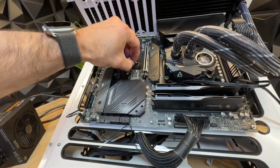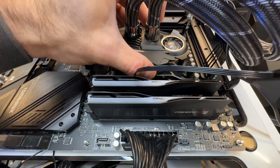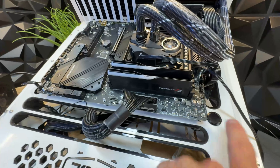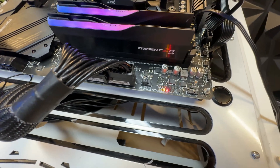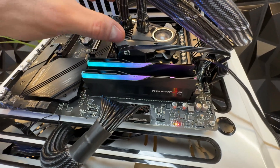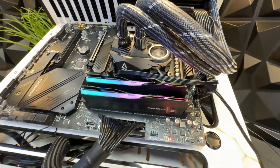Battery back in. Just to demonstrate — this thing is super duper loose, and that's how loose it has to be for the red CPU light to go off. Power on — red CPU light should go off. No. All right, we're back to square one. Maybe there's something shorting. I checked everything — there's plenty of clearance, nothing on the board. With a single stick of my own RAM it got to go into BIOS. So I'm updating the BIOS to the most recent version and hopefully I can add two sticks and get back to work.